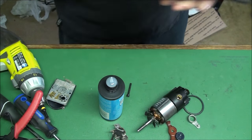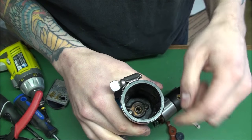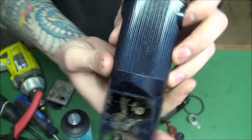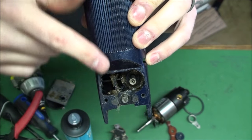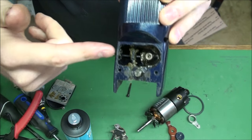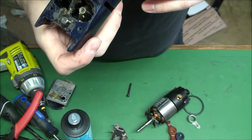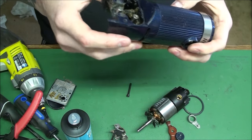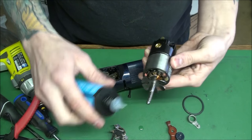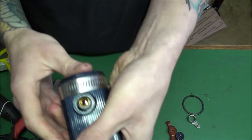I'm going to take this case and blow it out. Now you look down inside the case — see that little bushing? Let's go ahead and hit that. Then you're going to make sure this plate in here isn't too indented. It has a plate that wears out because the armature spins on it. But instead of buying a new case every time, you just replace that little plate. I can see hers is good, so I'm not going to pull it out. Put a little oil there — oil is your best friend.